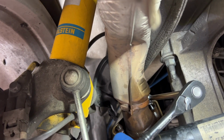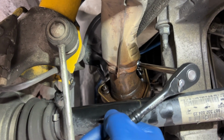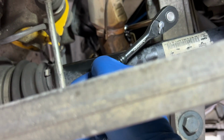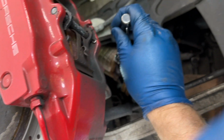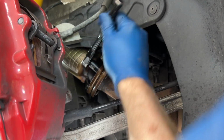All right, I got to that bolt with a little 1/4-inch ratchet and a 12mm swivel, and I was able to get that off. These are all 12mm bolts. Actually they're like studs because there's no head on the other side of them. Okay, I lied. We took the tire off here because this one is much easier to reach from there.